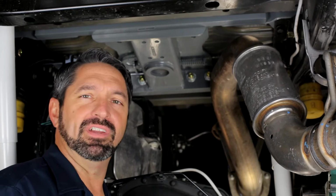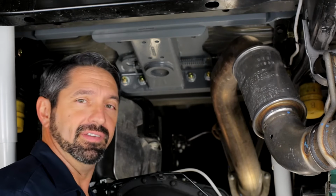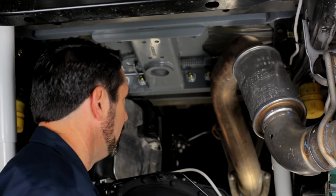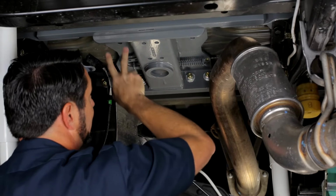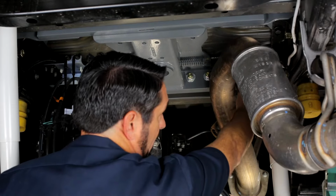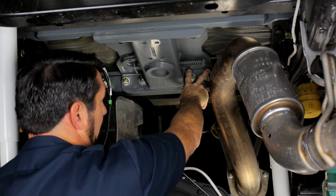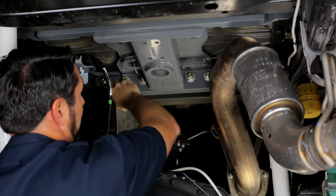Now that everything's bolted into position, it's time to tighten it all down. Now, given how much hardware there is in this particular hitch kit, it's very important that you follow the tightening sequence that's outlined in the installation instructions. The first fasteners that we'll tighten are the 1/2-inch fasteners that tighten the center section to the cross members, followed immediately by the 5/8 fasteners that tighten the cross members to the cross member brackets. Now, you'll need a 3/4-inch wrench set up for the 1/2-inch fasteners and a 15/16 wrench set up for the 5/8 fasteners.